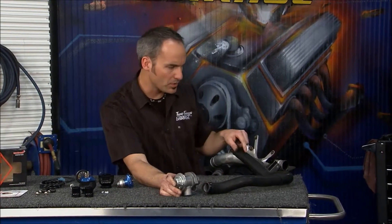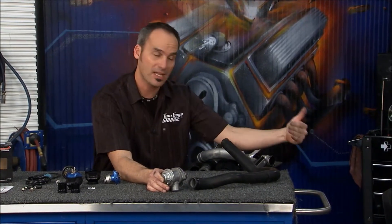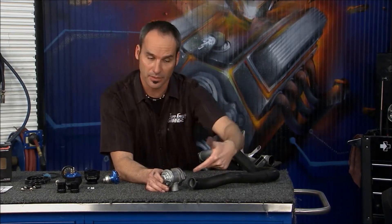Ready for a little surgery, a little dissection here? So we're walking through this — that high pressure hose right here was going into the throttle. I've got a lot of boost build up, and all of a sudden I close that throttle, it's got nowhere to go except my bypass. So I can bypass and put it right back to that turbo through the compressor, but I've got to get past this valve.